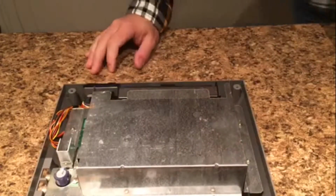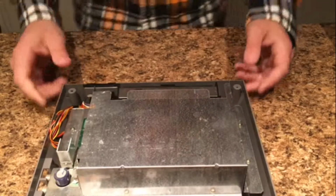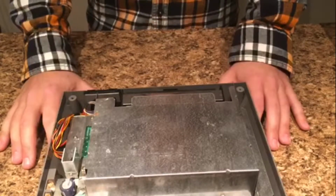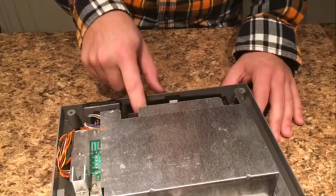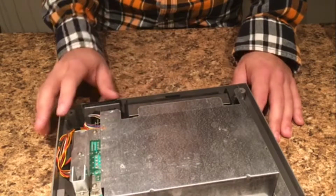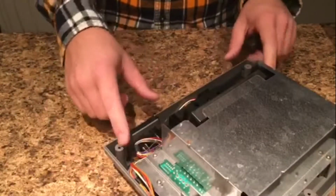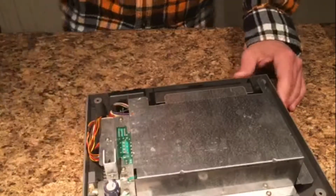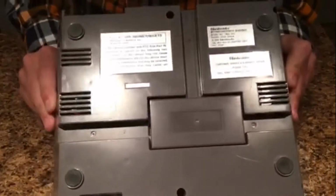Alright, I've gone ahead and put all those screws back into the console, as you can see here. And so lastly, you should have 6 screws left, because all you have to do is put the lid back on the console, and then you're done. Just at this point, double check that yours still does this. If it's not staying down, or if it's barely staying down, which sometimes will happen, loosen this screw and this screw. You want to do the ones that are around the front of this towards the middle. But once that is done, you can take the lid of your console and drop it back on. Since it's just a rectangle, it should fit perfectly. Turn it over, and we're going to put the 6 screws back in.